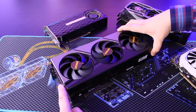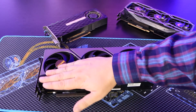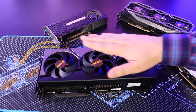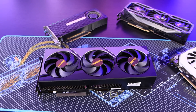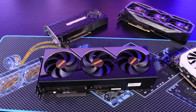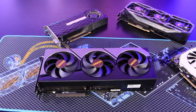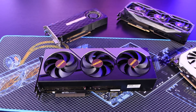It's about three slots thick, but in all honesty, if you're going to put another card underneath it, you're going to be blocking the airflow. Ideally you need four slots of room to get air into it, so I wouldn't try and squeeze anything else there. For something this beefy using 450 Watts of power, you don't want to restrict the airflow at all.